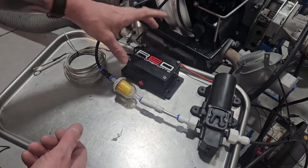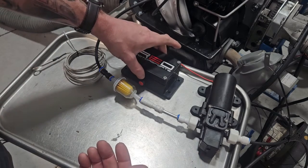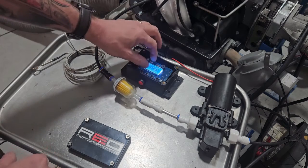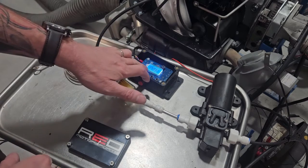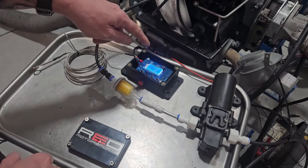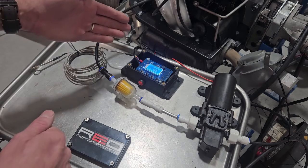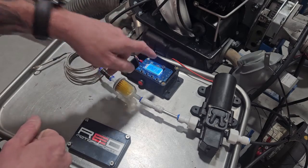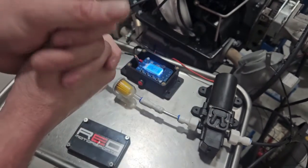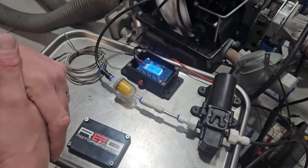We've added manual control, but let's show you the inside of the box since people are no doubt going to open it up. There's our circuit board mounted down inside, nice and secure. You can change your temperatures if you'd like. It has a display that shows you the temperature probe reading in Celsius. We set them up before we send them out — set to turn on at 375°F and turn off at 360°F. I wouldn't recommend changing it; I think 375 is the upper end of what's safe for long-distance heavy-load driving, and that 15-degree swing works out really well.